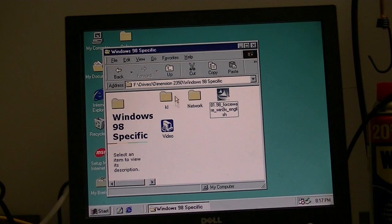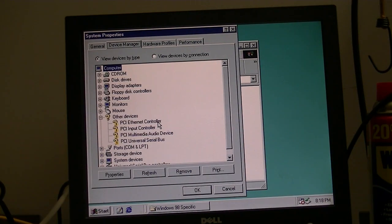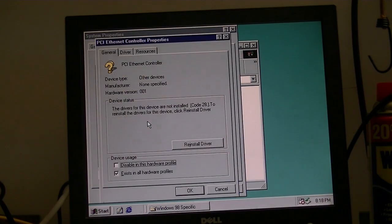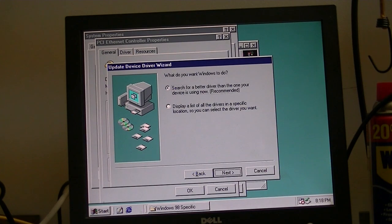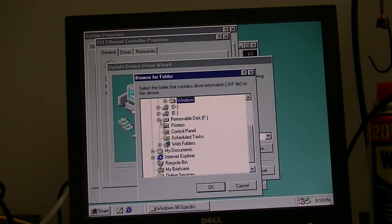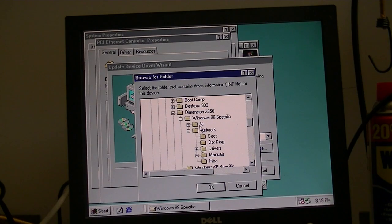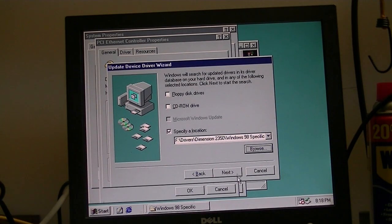Alright, now we'll install the network card. Again, the one Dell provides on their website only works with Windows XP, so you'll have to search around for the Windows 98 version. Again, I will put a link to that in the description, but once you get it downloaded, put it on your flash drive, right-click My Computer, go to Device Manager, and double-click on PCI Ethernet Controller. Go to Reinstall Driver, go to Next, tell it Next again, and tell it to specify a location. We're going to browse, and we're going to go to our flash drive. Go to Dimension 2350 here, and we're going to go to Network, and just select the network folder here, or whatever you have the folder named as.